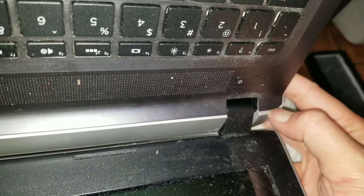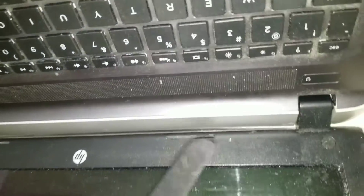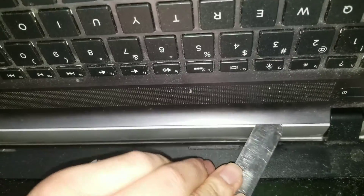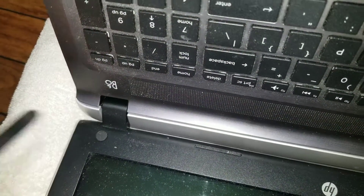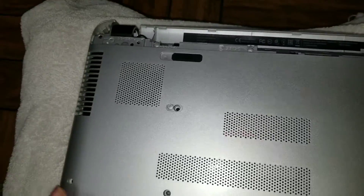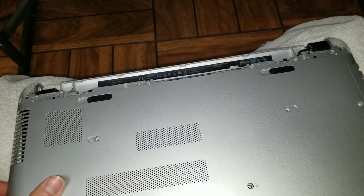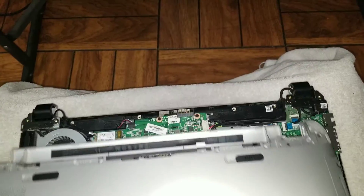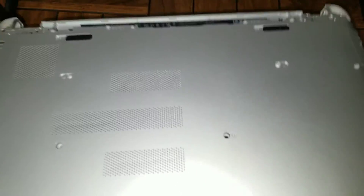The back edge will be a little difficult — I actually have to use a pry tool for that. When you get to the back edge, you can pull the gray piece out and then this part you'll actually have to pull downwards. Get the tool between the two layers and pry it downwards — you'll hear it click, which means the clips are releasing. Go along and do that all the way around. Once all those clips are released, close the lid again slowly. Then to remove the panel, push it forward to get it off the rest of the case and wiggle it out. When putting it back, put the back side in first and then slide the whole thing forward.